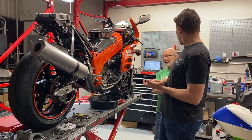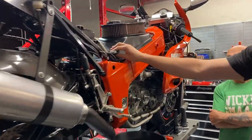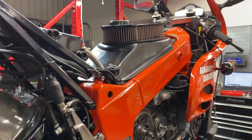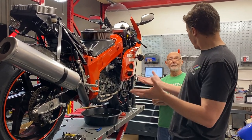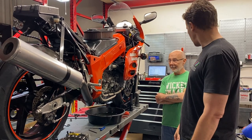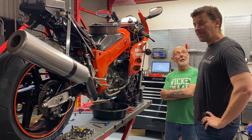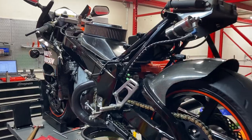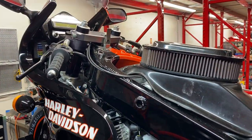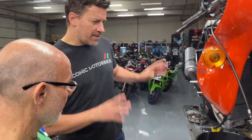The first issue was no spark because of the cam position sensor. We ended up replacing the cam position sensor and that fixed that problem. Then we got an oil leak on the oil pan — the way it sits at the bottom of the motor wasn't ideal. It was a zero-mile bike so it wasn't damaged, but the OEM gasket just didn't seal well, so I made my own. After a couple test rides the oil pressure light was coming on, so we ended up changing to a heavier regulator spring in the oil pump to get more pressure overall.